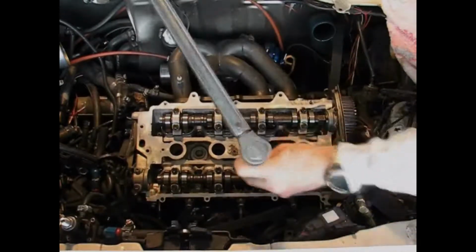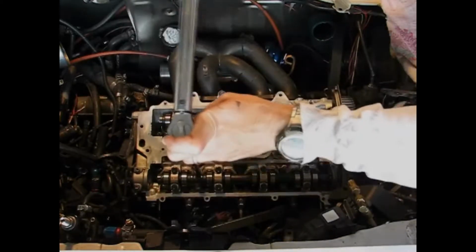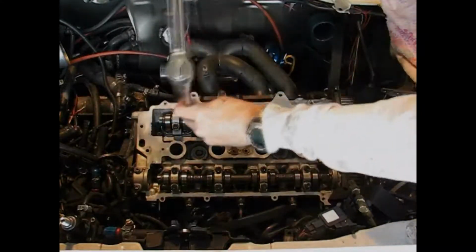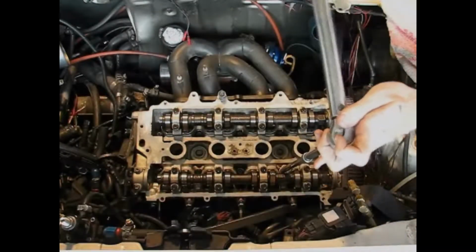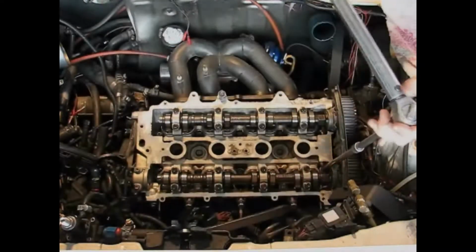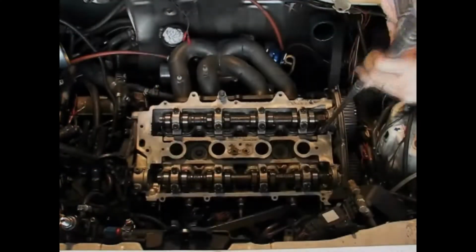Now we can torque those ARP nuts down. I followed the recommended ARP torque procedure and tightened the nuts in several passes up to 60 foot-pounds. Then I loosened and retorqued 5 times. Yeah, it takes a while. Make sure to torque the nuts in the correct order according to the service manual. Finally, make sure they are all torqued to 60 foot-pounds. It's generally a good idea to retorque the nuts after about 200 miles of driving.